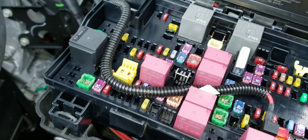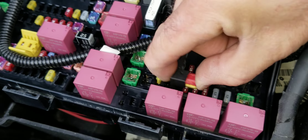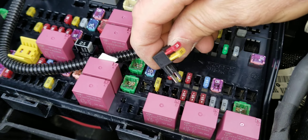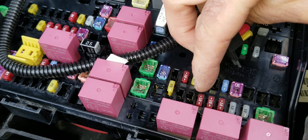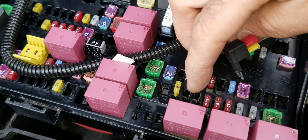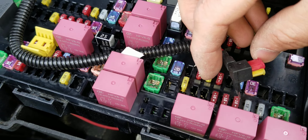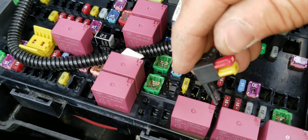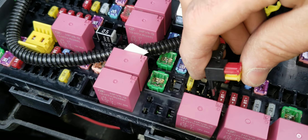The original two fuses I left in the circuit — I always leave them in the circuit. The ground I connected right here. I'll show you the fuse location: I'm using fuse adapters — in case this is your first time on my channel — 20 amps. The original one is in this location and is for the cigarette lighter plug-in, which is accessory-switched, so it will power on only when you have the key in the ignition. This is the radio fuse — the 10 amp fuse.